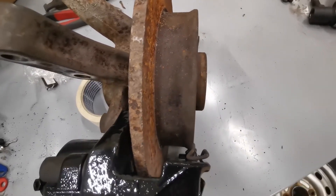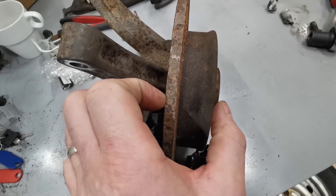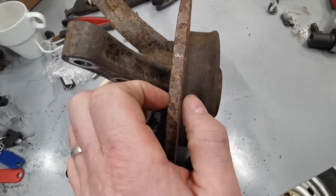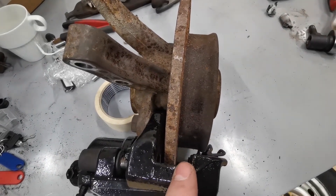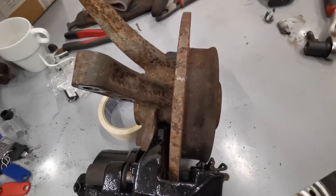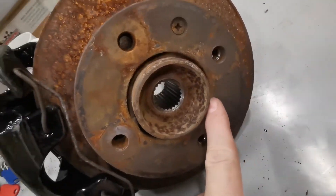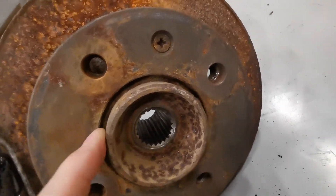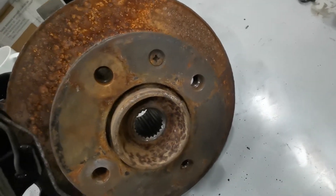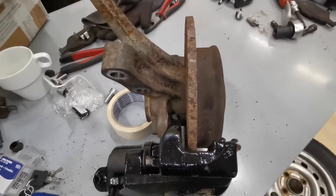What I've been looking at today is different combinations of brake discs. The ventilated discs for a Ford car are still 44mm in height, but the disc is 20mm thick, which means the gap on this side will get taken up by the rest of the disc with the vented one. The discs for a Ford car are 63mm in the center, and the hub here is also 63mm, so they will definitely fit. I've got a set of brake discs on order and they will fit perfectly.